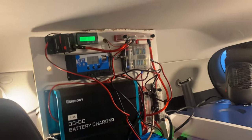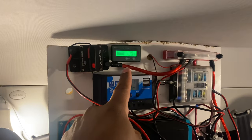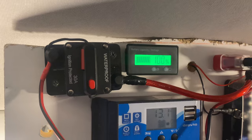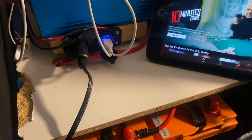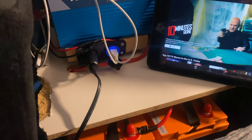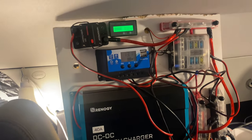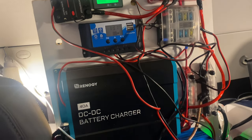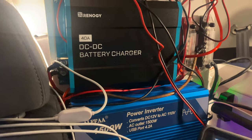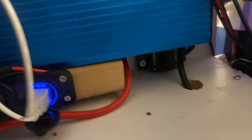Here's my fridge and here's my battery system — it's a little updated from the one you saw before. This is my battery monitor up here where I can see the battery is at 100%, and I was playing Fortnite with the lights on and the refrigerator plugged in. I have my LiFePO4 batteries down here hooked up in parallel, all bolted down so they can't come out. This is the 1,500-watt inverter, and the DC-to-DC charger — the battery will automatically charge as soon as I turn on the car, self-charging and self-sufficient. Behind the iPad is another circuit breaker I added to get more power out of these batteries.